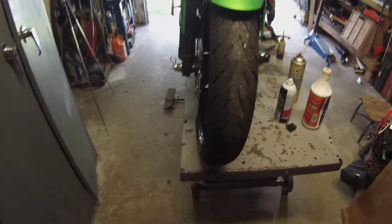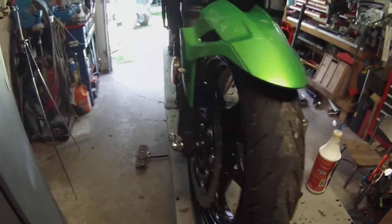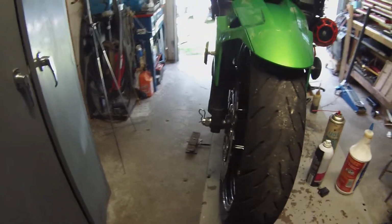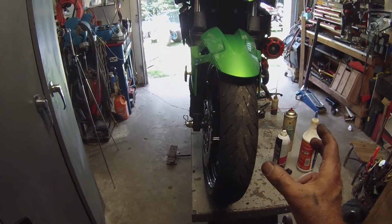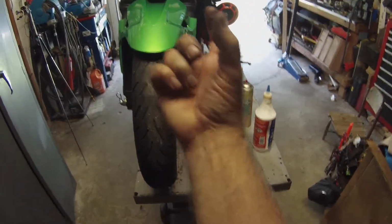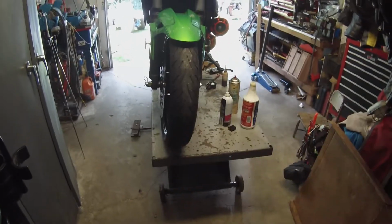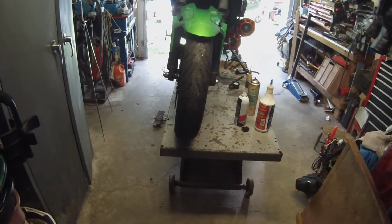That radial loading on the wheel bearings is especially true when you don't have a cap holding one side up. I like those better, but you know, you don't, because you're bringing your forks in, you're binding them. The ones that have a cap, you tighten the axle up. It doesn't have to be very tight, and then you tighten that cap. They suggest bouncing the front end up and down a little bit to get those forks to center, and then tighten that cap that holds the dull end of the axle on. I like those better. But you don't want to over tighten.